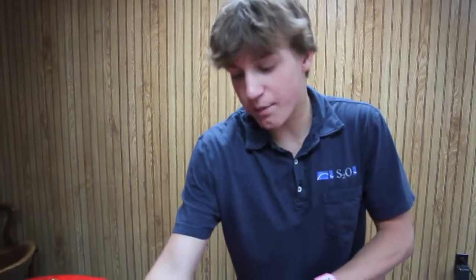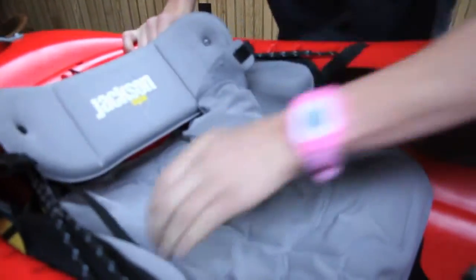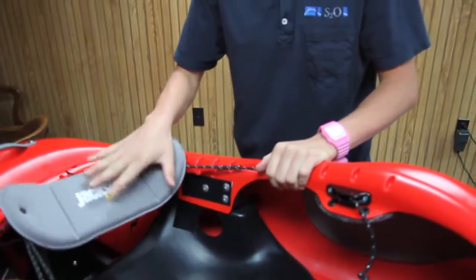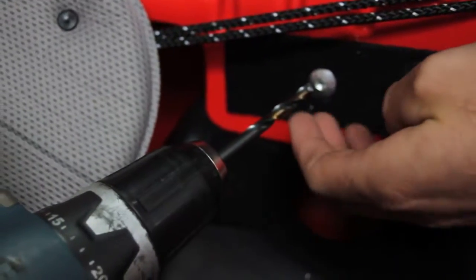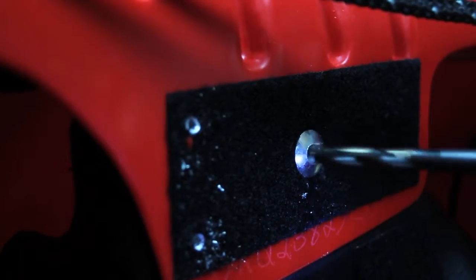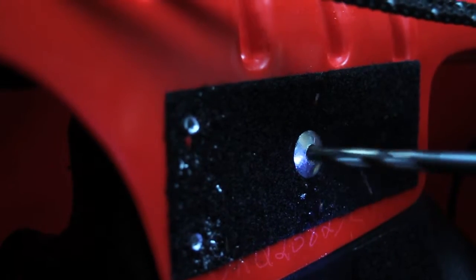The first things you need to do to retrofit your boat: go ahead and take out the sweet cheeks and the hip pads. You don't need to take the backband out — you can leave it in and attach it later. To take the seat out, using the one-quarter-inch drill bit, go ahead and drill out the rivets on the side tab. Make sure you use protective eyewear because the little metal shards can be dangerous. Take the drill bit and stick it directly over the center of the rivet and slowly drill through until the head falls off.